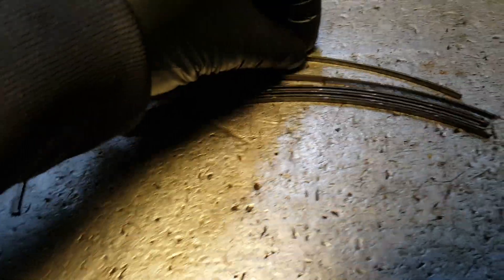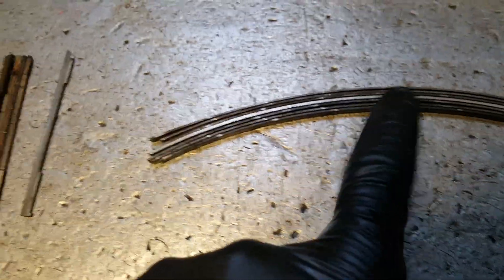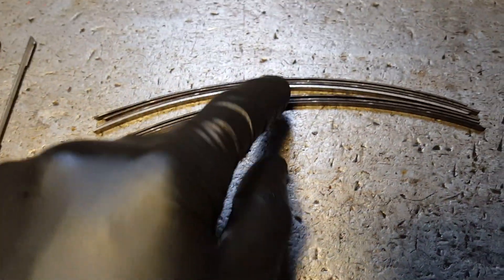When you install the side seals, there's some type of triangle face or shape. One side is a little bit wider than the other. See how that one looks chrome — that's the side that touches the iron, so it goes outside on the rotor. The black side is dirty from carbon buildup. It's like a little triangle shape, so there's only one way to install these.